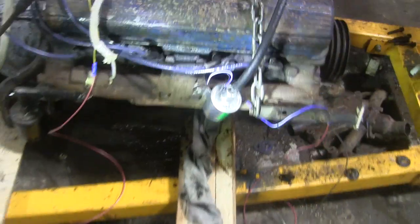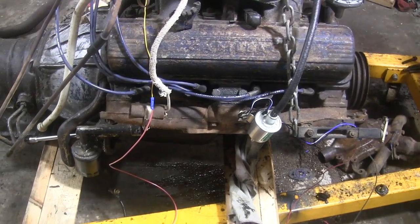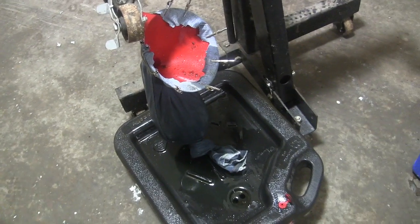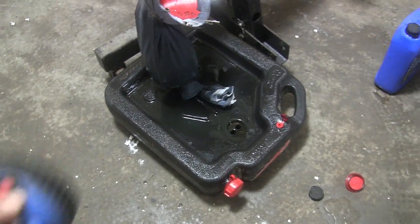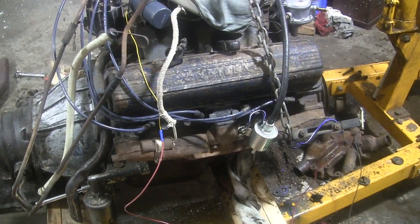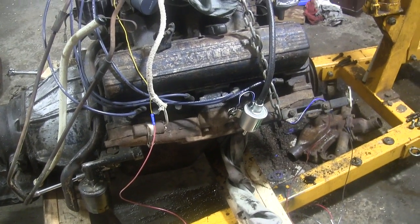And right now I'm using old coolant because it's still going to be below freezing, so I don't want to use water and have that get trapped in the block. So using the old coolant out of it, and I'm filtering this stuff here just to take kind of the big chunks out. Got an old pair of jeans there hooked up to a funnel, and I'm just letting it run through there. Cleans it pretty good, but takes a while. So after that's done, I'll dump those back into jugs and put that pan underneath again and keep flushing it. Probably take a while. And I've got the new block plugs on order, so I've got some time to flush, so hopefully we can get all that crap out of there.